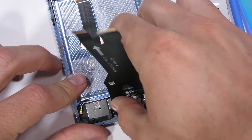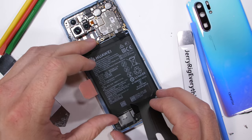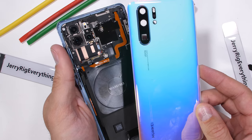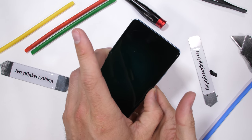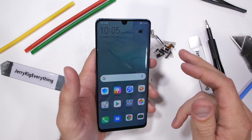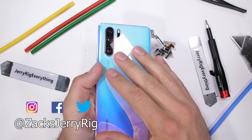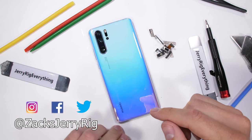I'll get the charging port back into its slot, drop the bottom plastics back on, and scooch the battery back into position. The rear plastics, wireless charging, and 17 screws hold everything in place, then the colorful rear glass panel goes back onto the P30 Pro. Even without the periscope camera reinstalled, the phone still turns on. A fully torn down and reassembled Huawei P30 Pro — one of the coolest phones we've been inside of so far this year. Hit the subscribe button if you haven't already. Thanks a ton for watching, and I'll see you around.